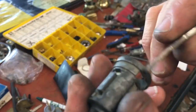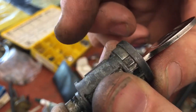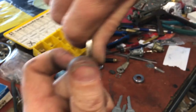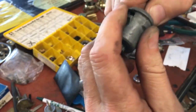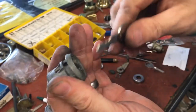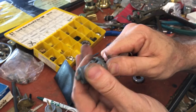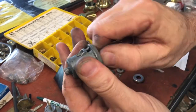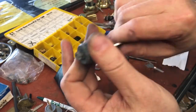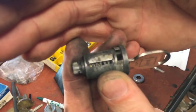It's a little corroded, so the sidebar did not drop really on its own, but it does completely drop. We'll check it in the cylinder. That appears to be it — let's put a little lubricant on it. There it goes — it should free up. So there we go: you don't even need the decoder to do it. You can pretty much visually decode the key.